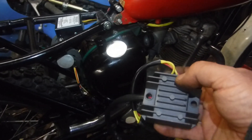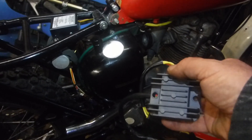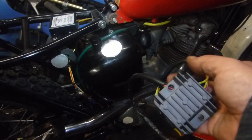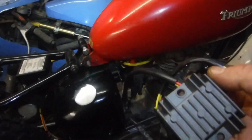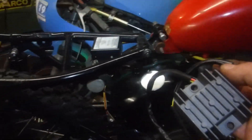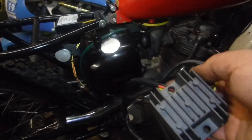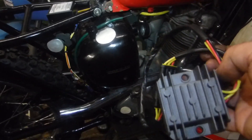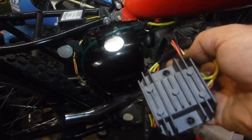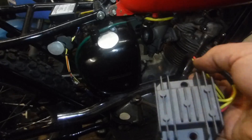But I was left with one of these, which I thought was faulty. What it did on the Trials Cub replica when I connected it up to the alternator — I could get output from it, but it seemed to be cutting in too early or at too low a voltage, and the bulb I was using to test things was only lighting fairly dimly. I tried it on this machine yesterday with the battery charger still hooked up, and again the light came on but it was dim. The regulator rectifier was obviously cutting in because at tick-over the light was bright and flickering, and when I revved it up a bit it dimmed and steadied — but it seemed a little bit too dim for my liking.